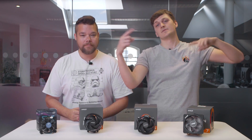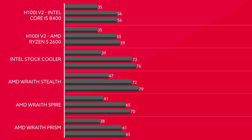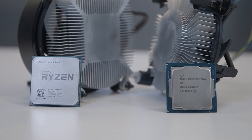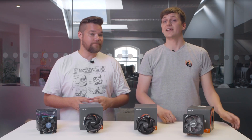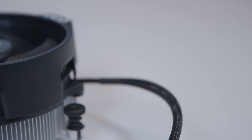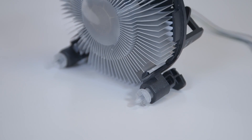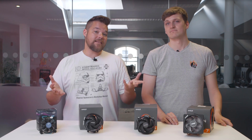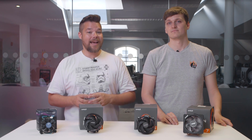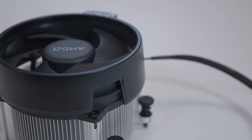So here are all the scores combined. The higher idle temperatures almost across the board for Ryzen seem to be related to a difference in the efficiency and power-saving states of Intel's 8400 and AMD's 2600 — the Intel chip clocks down around 600 MHz lower. The AMD stock coolers were much quieter, at least. When it comes to load, it's a pretty fair fight between the Wraith Stealth and Intel's stock cooler, considering both feature similarly lightweight aluminium heatsinks and near-identical fans. The Intel cooler, perhaps surprisingly, actually edged the competition. When it comes to AMD's bulkier stock coolers, however, the Red Team has Intel overwhelmingly beat.